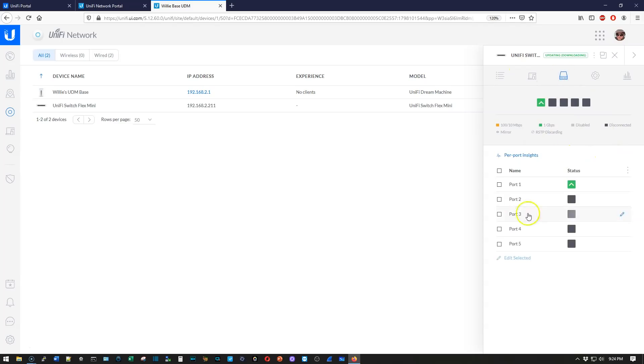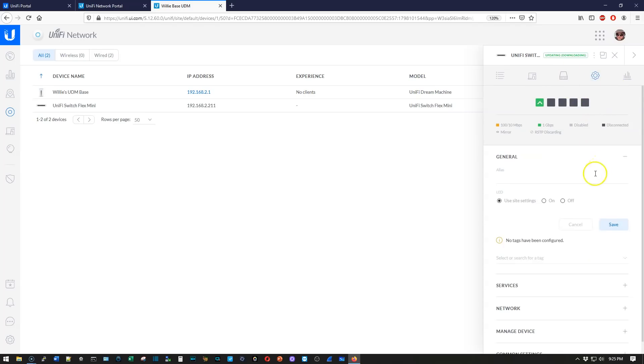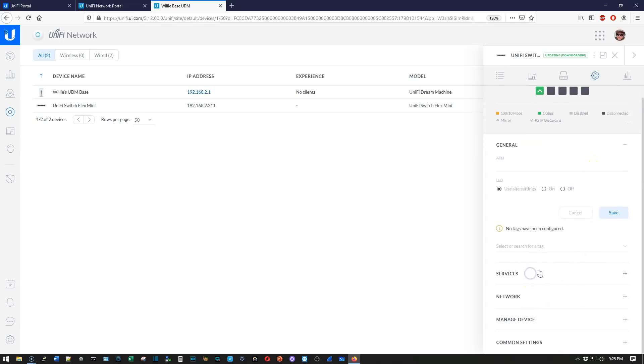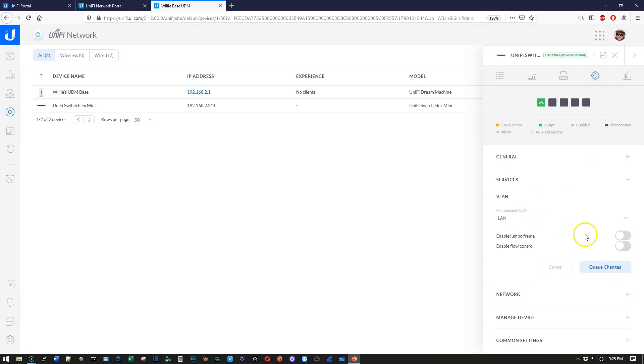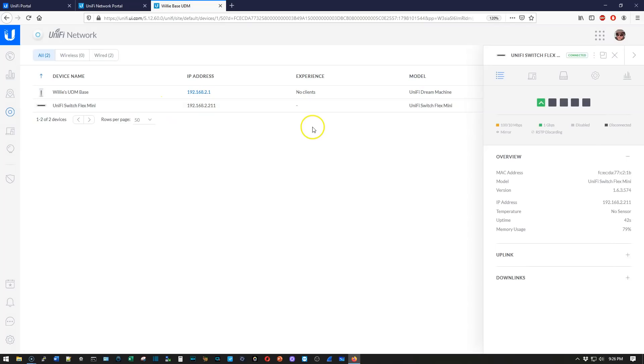You've got your clients, you've got your ports. We can go in here, we can edit a port and do all the things. We can come into config, change the management VLAN, do jumbo frames, do flow control. Here's my favorite thing to do: turn this $29 switch into a gigabit ethernet tap. And how are we going to do that?